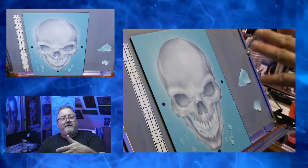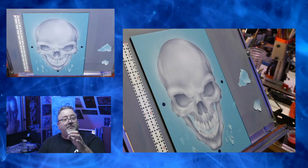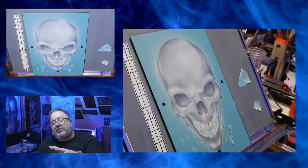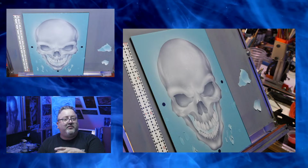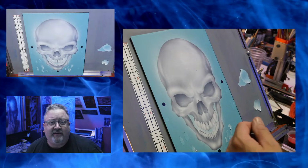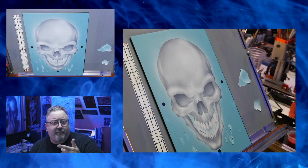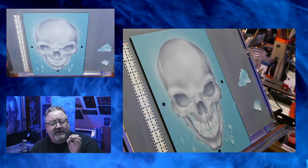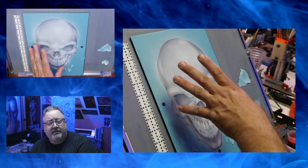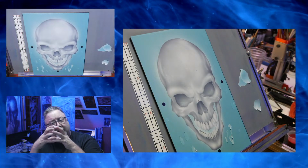You just have to be a little bit more careful with that soft overspray mist, because the illustration colors are designed to be erased. They stay soft for quite a while. Therefore, masking can pull it up if it's too dry. So you just gotta play with it. But yeah, I put a little 40-50, and then my reduction, which is 4 parts 40-11 and 1 part 40-20. I find that 40-20 extra heat really gets into the base that's already down. Remember, this base coat was down with a little 40-50 over it. So it's reactivating that 40-50 just enough to give a chemical bond.